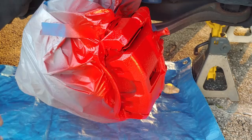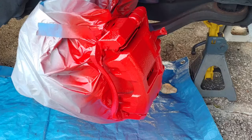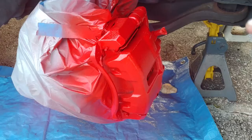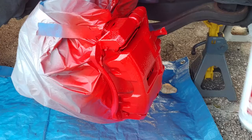This last coat we want to put on thick. You don't want paint runs, but you want enough paint that it's getting pretty close to one. Even if you do get a paint run, honestly I'd rather have a paint run on my brake calipers than have them a little too thin. They're going to last substantially longer when this coat is thick, so lay it on there and don't be afraid.